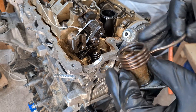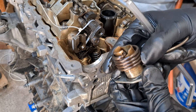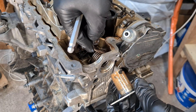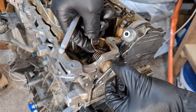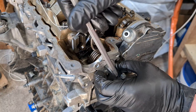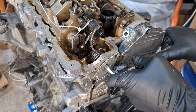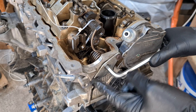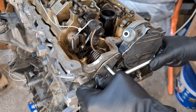Now let's see how this works. There is a cutout here on the carrier and a band on the spring — this basically just hooks up and keeps the spring in place. So after you replace the o-ring and clean the surface, align the spring like this, give it a bit of rotation. If you have a mark here, you can go about 100 degrees — this is where both pieces align. Then take your allen key, tension the carrier, and keep it under tension. Make sure the bolt is all the way in so the thread doesn't get damaged, then do the same for the other bolt. You'll have to apply some more tension on the carrier to get the bolt in the correct position.